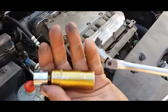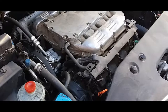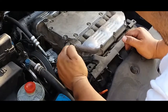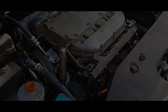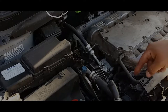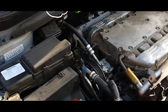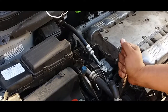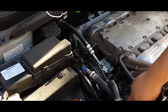I'm going to trade this extension for a shorter one — this one is too long and it's getting in the way. Now that I have it in place, simply pull forward. The power steering hose was in the way, so I went ahead and removed it. Then I grabbed it with the 19 millimeter socket, put it on the tensioner breaker, pushed forward, and you could feel the tension on the breaker release. Then you just take the belt off — the belt is off.